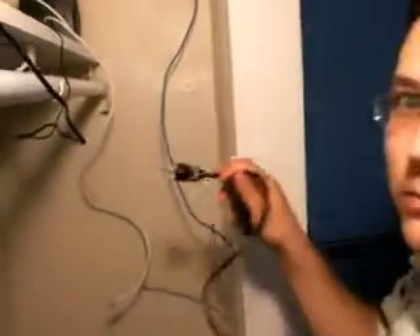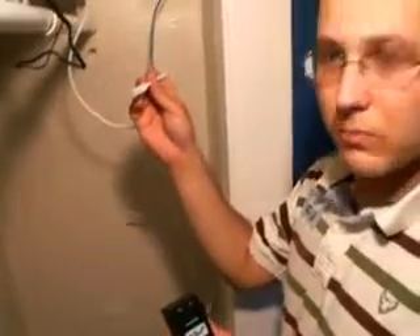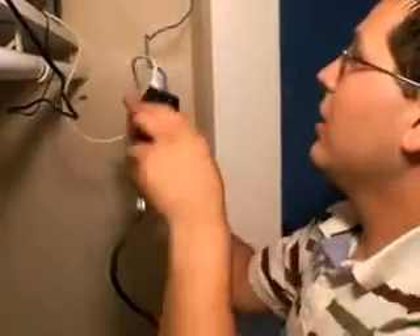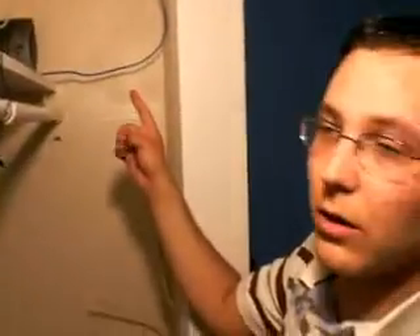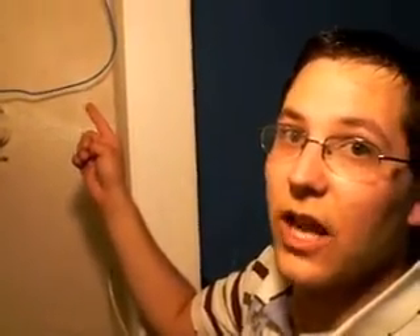Now all we've got to do is take the power cable to our power over ethernet injector and plug it in. The line that we have going to the modem, to this POE station, is going to plug into your LAN port. Your line that's going to your Pico station is going to go right into your POE port. We're going to put this up here out of the way and plug it right into the power. Now it's going to take about two minutes — it's going to take the internet and run it up, power up the Pico station, our access point. The Pico station is going to connect to the servers, and the servers are going to verify over at hotspotpa.com. And once that's all done, you're linked up and we are ready to configure it and get our hotspot up.